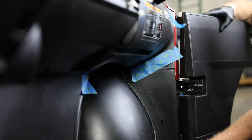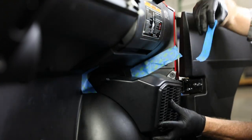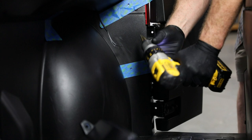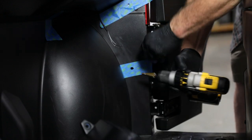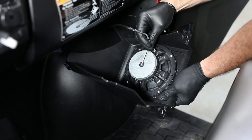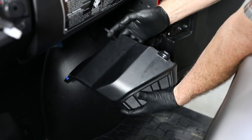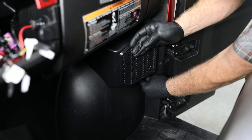You may want to use a work light while marking drill holes under the dash — it gets pretty dark down here. Use lightweight painter's tape and a Sharpie to mark the place on the inner body panel where you want to drill. Mark the three mounting holes for the push rivets right on the tape. Now set the speaker aside and drill the three holes — be careful not to go deeper than the plastic panel of the vehicle. Once the mounting holes are complete, wire up the speaker: put the harness into the notch in the housing, connect the small connector to the small terminal, large connector to the large terminal. Mount the speaker with the three push rivets, making sure the speaker harness remains outside the pod. Mount the speaker on the other side with the exact same process.